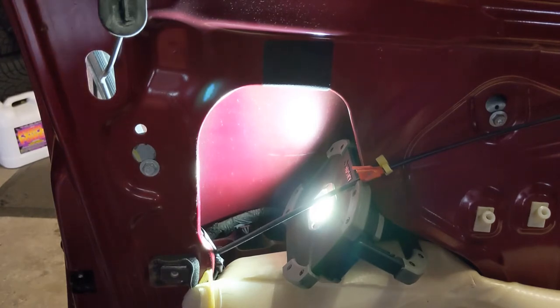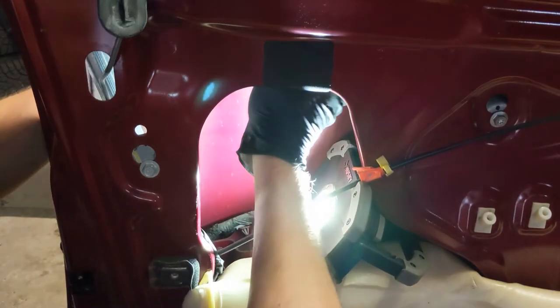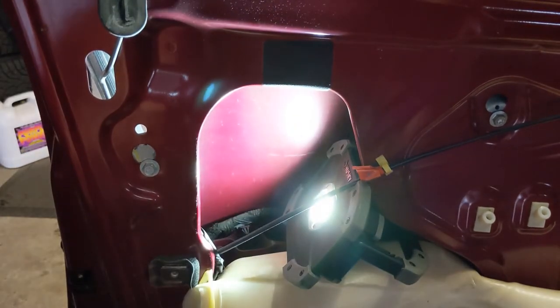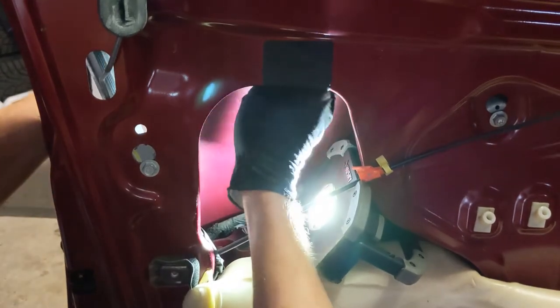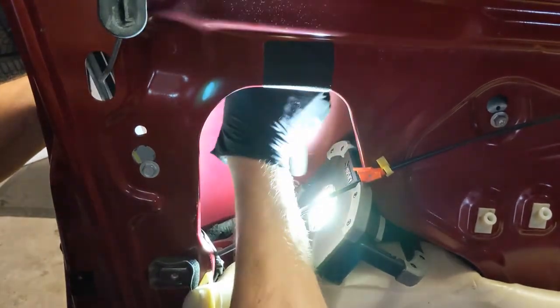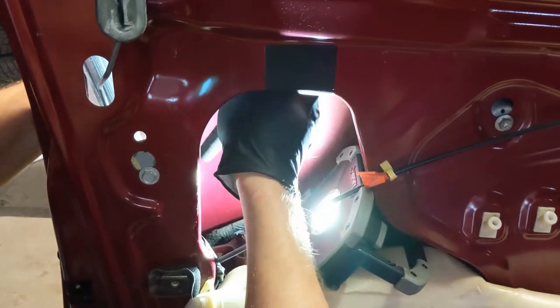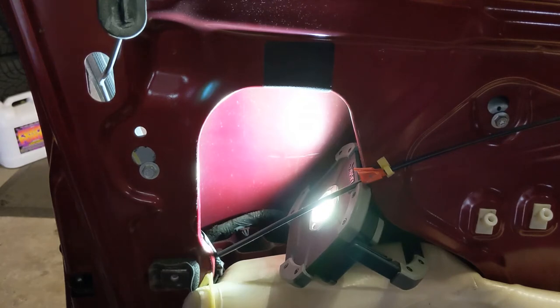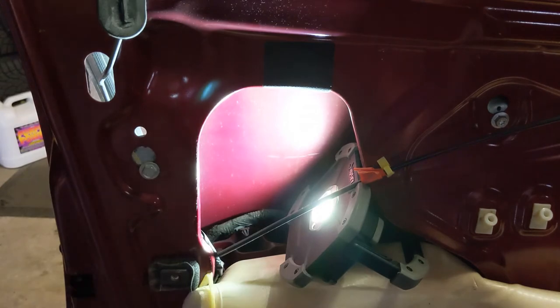What I'm really gonna do is attach this door handle — reattach it before I snap that lock rod in there; it'll make it easier. This'll be stationary. You don't want to torque the bolts too tight — you don't want to strip out the little thread-serts, nut-serts. So I'm gonna throw this on here.